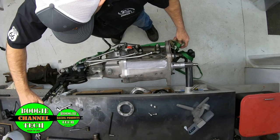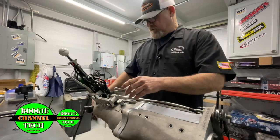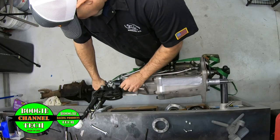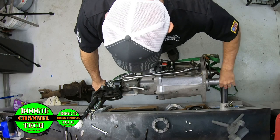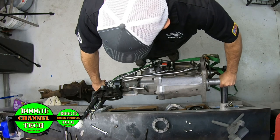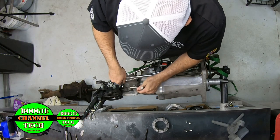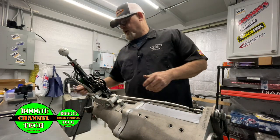We're against the stop. We're in fourth gear — checking it. Yes, it's got a lot of drag on her. So now we start pushing on the stop and we loosen this up, adding a little bit of drag adjustment. Oh, that's sweet there. Now we've got fourth set up just like we want it. Snug up the stop and there you go.